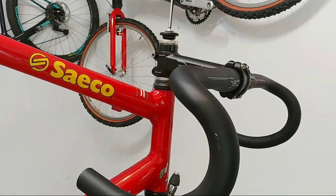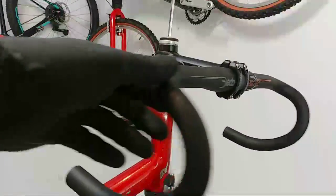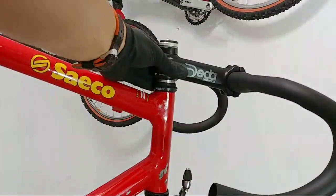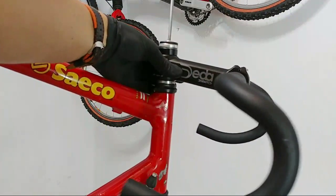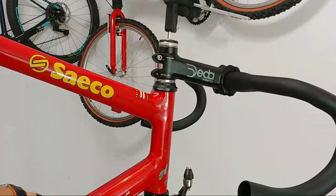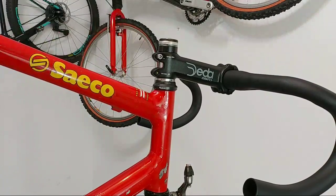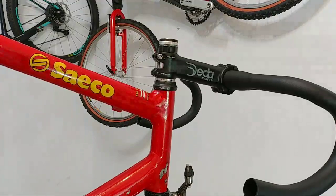Cool. We've got a 5mm Allen key right there. As you may know from my episode about the bike maintenance, I told you that this one will put some preload on the headset bearings, like this. Cool. I'm not fixing it exactly how it should be. I just want to have it fixed so that we can put the shifters on it.